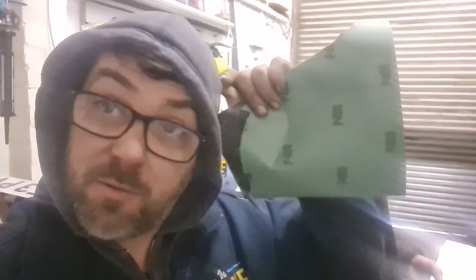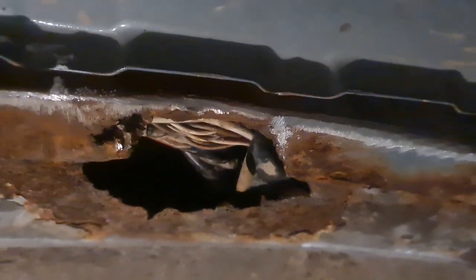As you saw in the last video, we got a lot of rot in this wing. We've done the rot in the other wing, so we've started the rot in this wing. We've got the liners out and we've started cutting away — we've cut out this bit and there's some more around here. You've got to be careful in this area because it's right by the loom and we don't want a repeat of last time. Also down there you find the foamy material that catches fire relatively easily, and you've got the loom up there, so this side's a bit more difficult. We're going to use the Dremel with a little grinder to cut that so we don't catch the wires.